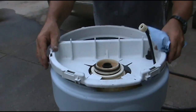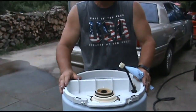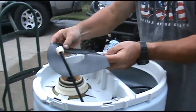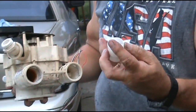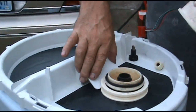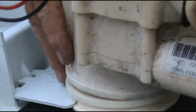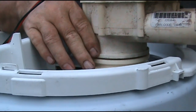Put this right here on there, give it a little twist, and let it snap in place. Come around here and pop it down — it should be secure. This is the salt level indicator cap — stick it down here and put it on. Now I'll go ahead and install this seal — push it on there. Before I put the motor back on, there's an impeller in here — take it out because if it drops and hits the ground it could break. Put this plate in — this side up, right down in there. Now I'll put the shaft inside here, making sure the O-ring is seated down on there.